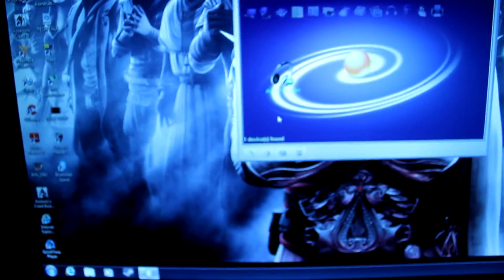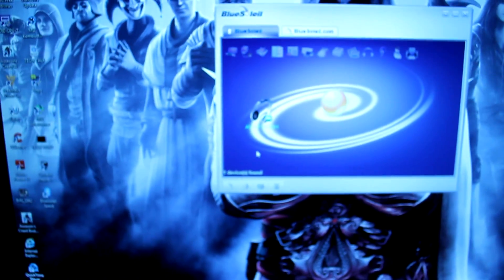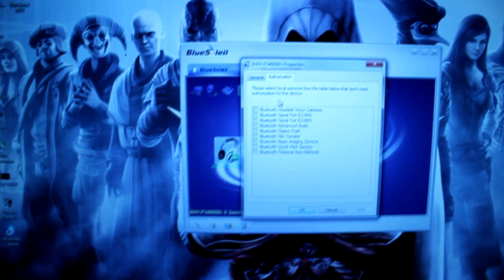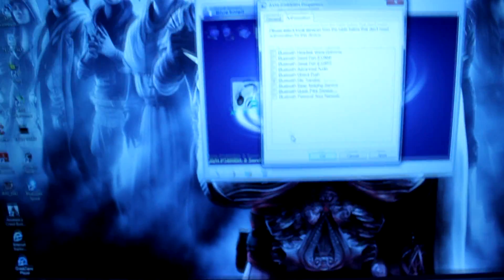Sorry you can't see this — trying to get as close as I can. Right-click it and it's already paired. I did this already so it's paired. But you would right-click it and pair it, and once paired you'd get a screen that says Authorization. I entered the code 0000 and said yes and it paired. Then right-click and go to Properties, go to the Authorization tab, mark the box for Bluetooth File Transfer, and click Apply and then OK.